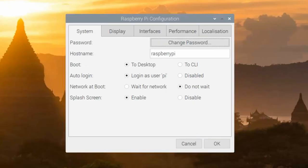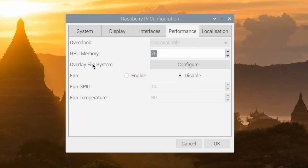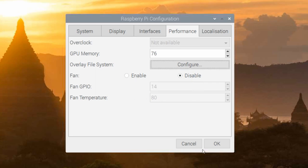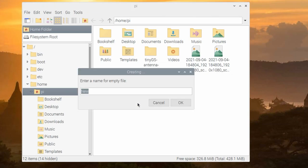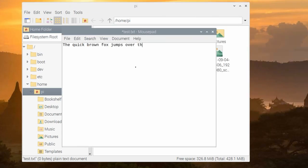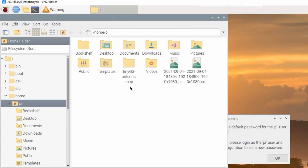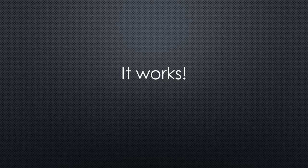Let's try it out. We open Raspberry Pi Configuration on the desktop, go to Performance and to Overlay File System. There we hit Enable and get two choices. We can create the overlay file system in memory, set the boot partition as read-only, or both together. It warns us that we have to reboot to get it working. We select both. After that, we reboot and test. We create a file in our home directory and add some text. Everything works as usual. If we close the file and reopen it, the text still is there. Only if we reboot, the file is gone because it only resided in RAM. So the feature seems to work.